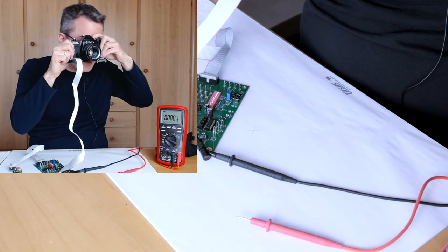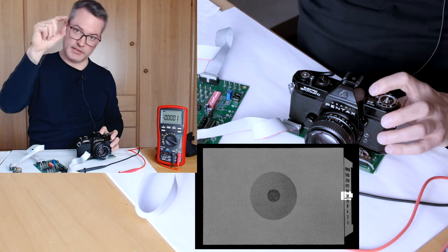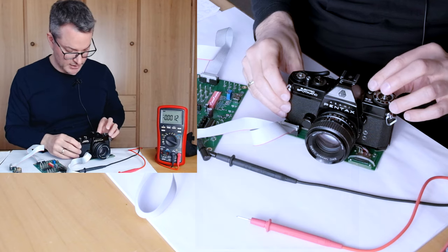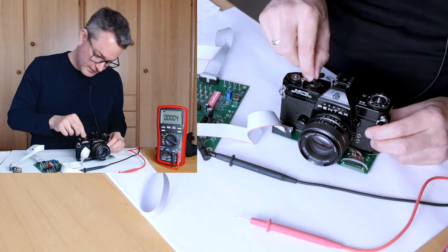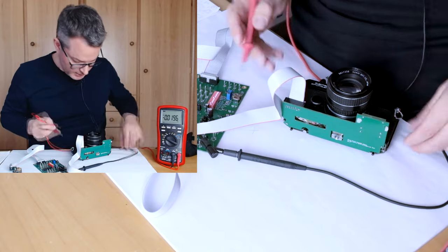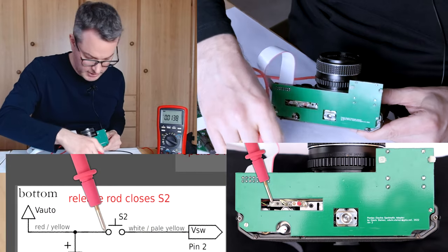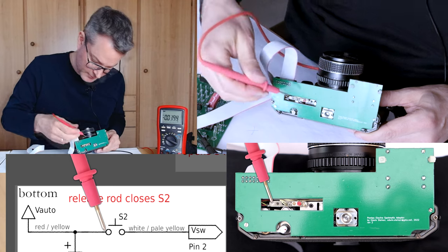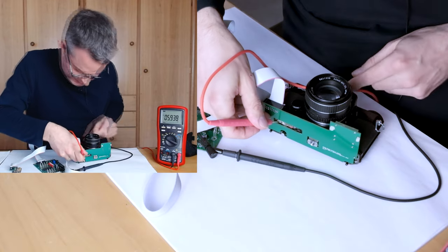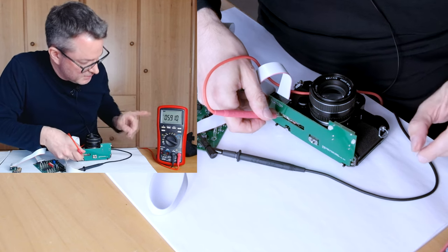Let's check if the battery check does something if I depress it. Yeah, it works perfectly — the indicator of the meter immediately moves up into the notch at the side that is opposite the 1/30 second mark. So that's the expected operation of the battery check. As soon as we have the camera in automatic, we should see the battery voltage on the input of the shutter release switch. I have clamped the common lead of my multimeter to ground, and here we should see about 6 volts, and we do.